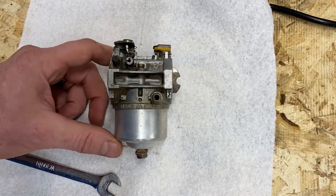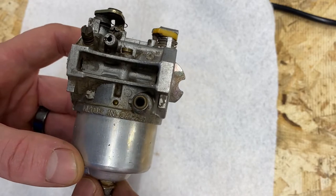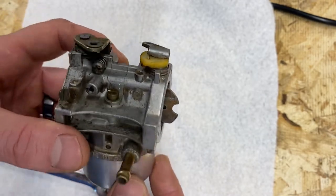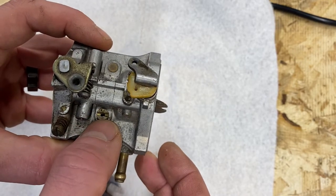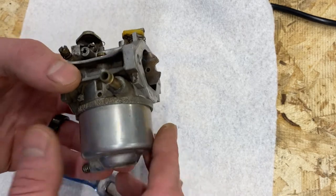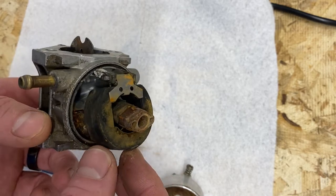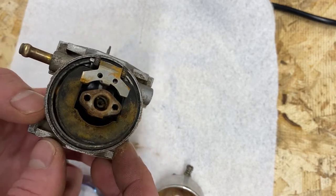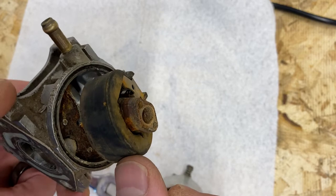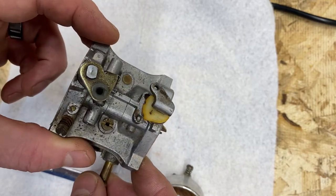I've got the carburetor pulled off and before we get all weird with my new fancy high-tech cleaning method I want to show you exactly why I want to go down this route. This carburetor is from the 80s — not a cheap Chinese knockoff, this thing's made in Japan. It's a Mikuni carburetor, a little more complex than your typical Briggs and Stratton. When we open it up — I mean this thing is jacked up. Usually I'd take it apart and clean it with carb cleaner and brushes, but my worry is that if I try to take that jet out it's all rusted and it's going to completely fall apart. Look at that rust in here — it is gnarly. This is one of the nastiest carbs I've seen in a while.